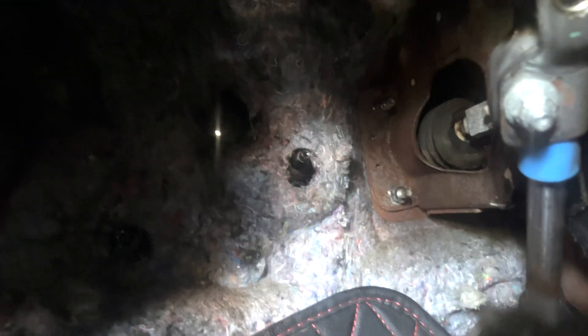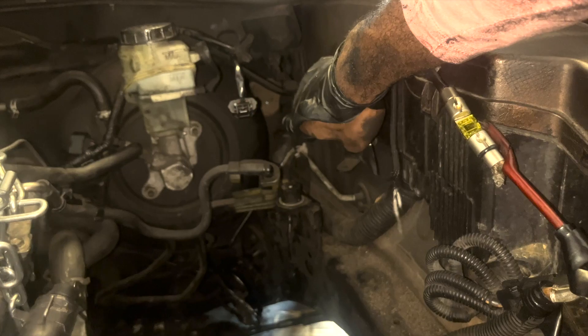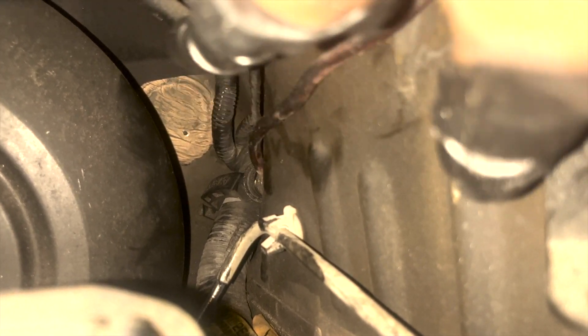Now what I'm working on is where the master cylinder is going to come and poke out of. You can see that little tiny hole where light is coming through — that is where I have to make a hole to fit the master. I drilled a little tiny hole first so I can see where the bit comes out on the other side, and I just have to widen that hole and make it really big. On the other side, the master is going to poke out right back here. I had to pull these wires out of the way to make sure I don't nick them because that's really bad positioning. I tied a rope around them, pulled them out of the way, and I'll be able to widen that hole slowly until the master cylinder can go through.